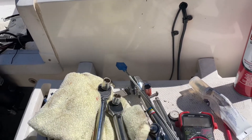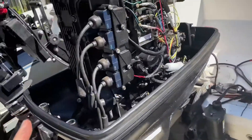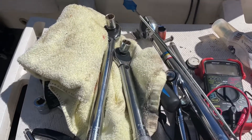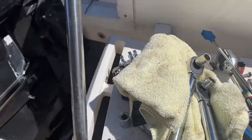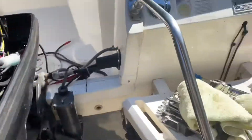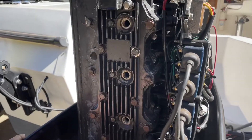I needed the middle torque wrench to hit the specification because 225 inch pounds is at the very low end for my big torque wrench and at the very high end for my little torque wrench. So I went out and got this one. I didn't spend a lot of money on it, but I figured I could use one to creep up on the other to make sure they're agreeing with each other.